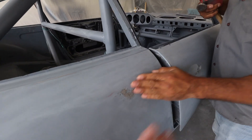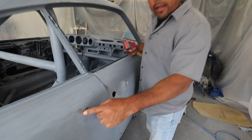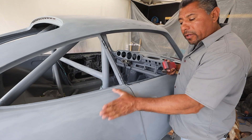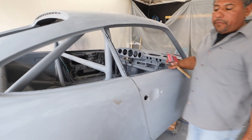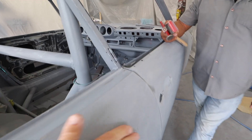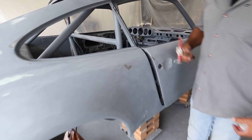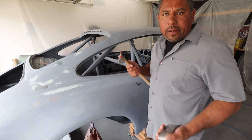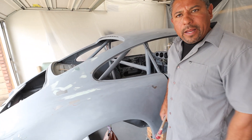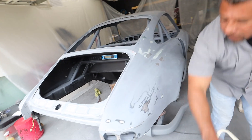The idea of the skimming is to really reduce the frontal impact — because if you hit it straight, you're going to have a straight dent. If you're kind of pushing the metal around, you can even go another direction — almost like how you sand that way. That's flatter for sure. You could take a block, tip a little glaze on it, and if you still feel high, do the same thing. It's just a matter of getting it right.